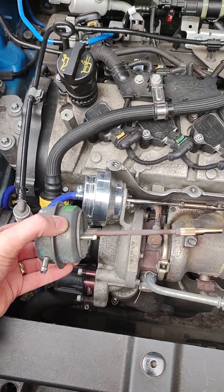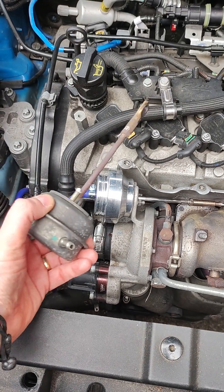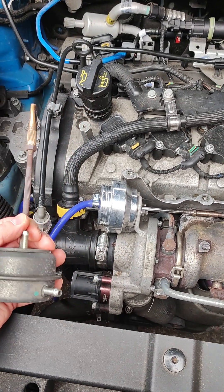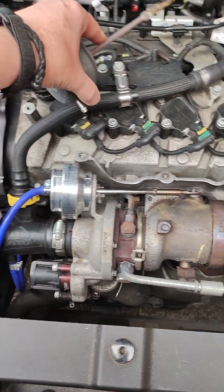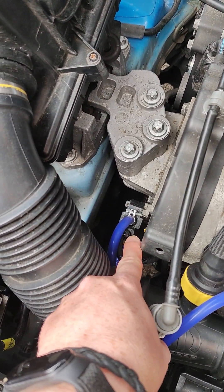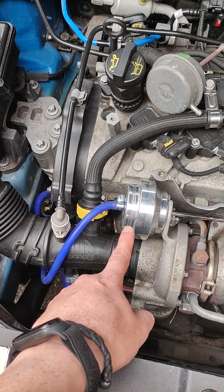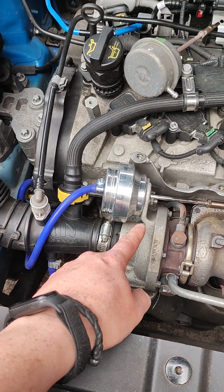Here is the original. This was pressure tested — the original seemed to be working fine, opening at 10 psi, which is the standard for these vehicles. There's also a boost control solenoid which holds the boost if you need to slightly over-boost before it opens the wastegate.